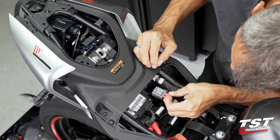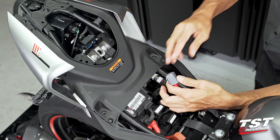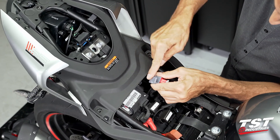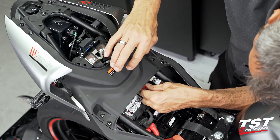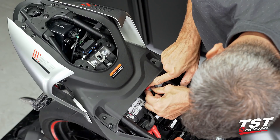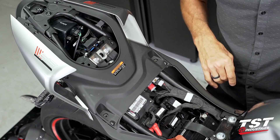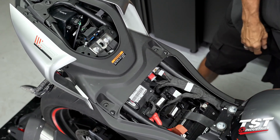On this component, we could either try to feed it through that small channel in the rubber boot where the OEM relay came out of, or we could sit it right on top. The key being, we have to engage this tab into this little window of the keeper. It's going to be a tight fit in there, so I'm going to get myself prepped here by bending back on the tab just a little bit to make it easier to get that targeted into the slot. Once it's engaged all the way, make sure that the connector is still plugged in. Give it a quick test before we close everything up — you're flashing at the right rate. Now we just go into reverse order of disassembly.